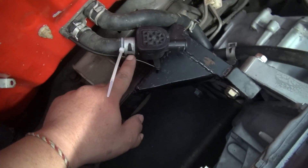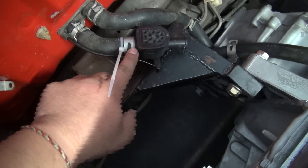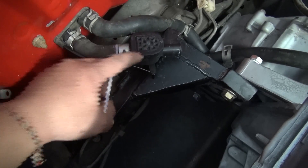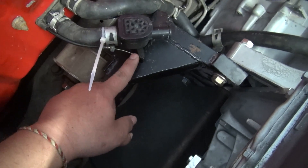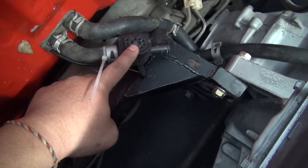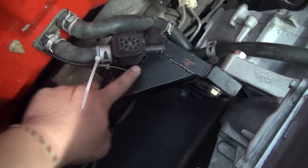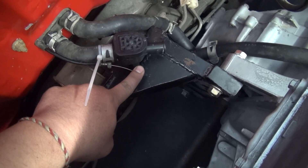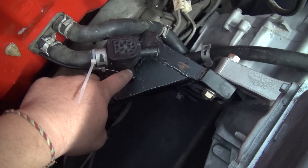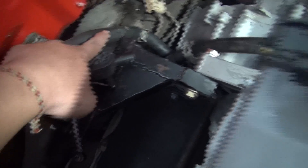The tricky part was cutting it to the right length — this one I had to cut about an inch and a half off, but you have to do your own measuring. The tricky part was converting it to go that way while still keeping this line functional. This is the line that opens and closes the hose to the heater core, so it has to be on or off. If it doesn't work, you're gonna have heat all year round or no heat all year round.